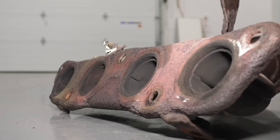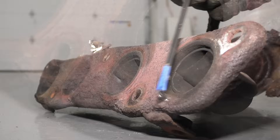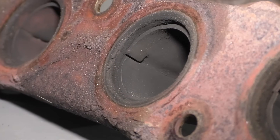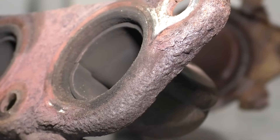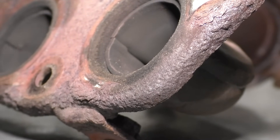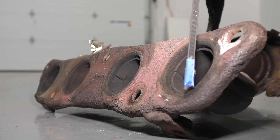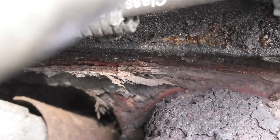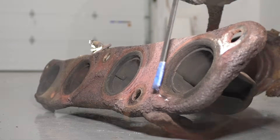We've got the manifold out so we can take a quick look at it. There are a couple of common places you'd want to look for a leak. One of the first places I would look is right along this area here — it should be very flat because there should be a gasket that runs across these, between the manifold and the engine. If you see that there are a lot of raised areas and lower areas, you can make a pretty good inclination of where you might have a leak. Sometimes you might see some black or even some white coming along those lower areas — that's pretty much where the exhaust leak is coming from. This might occur because the hardware loosened up a little bit, creating a gap where the gasket is supposed to hit against the engine or manifold, and you might get buildup or corrosion.